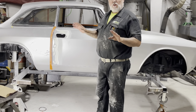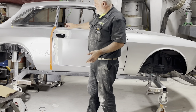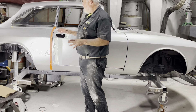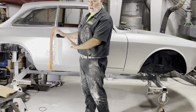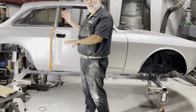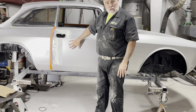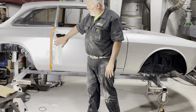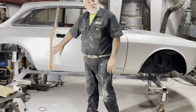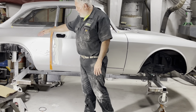I solved most of it — most of it is corrected, rectified, and tolerable. The gap is 4.8 millimeters; however, that's going to change because I'm going to have to cut more into the quarter panel, weld it back up, re-measure it, and sand it down to re-establish 4.8 millimeters, because this door is original — original skin. I sanded this down because too much body filler was applied, way too much — it brought it way out.